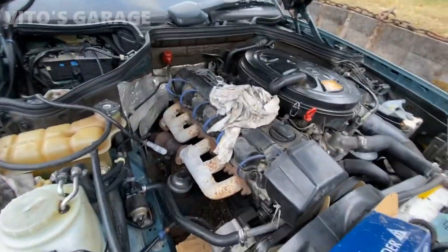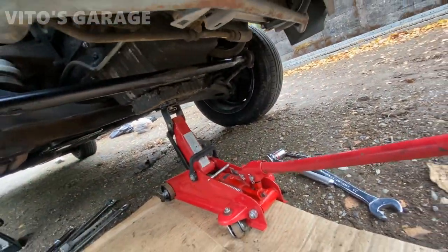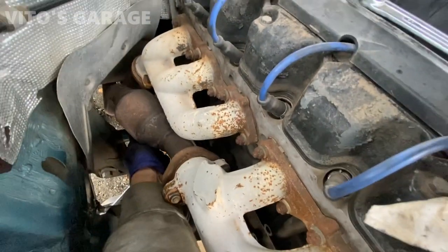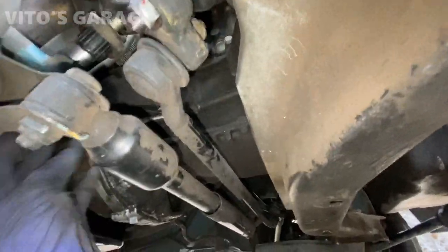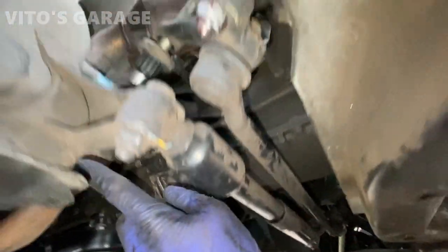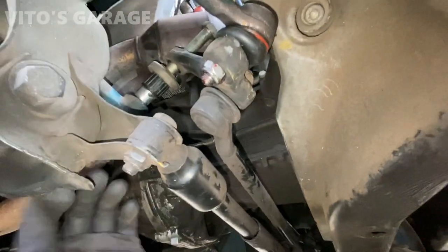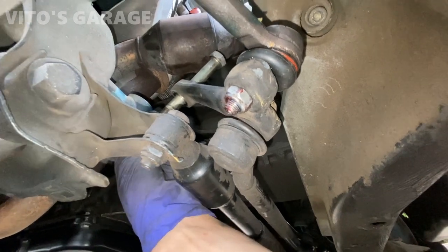On this car I decided to remove the bolt on top of the engine mount and lift up the engine a little bit - right there as you can see. What I did is I pounded out the old one, as you can see right there, so now I can just go ahead and remove this thing. I'm going to go underneath and show you some more. Here we are underneath the car - as soon as I removed the nut, one half of the bushing came right out, that's how bad this thing is. Then I pound this out - once you pound it out there's going to be more room to move with the bolt back and forth.